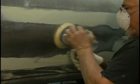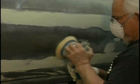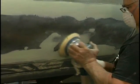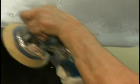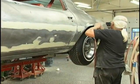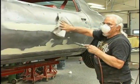This is critical. We're going to wind up DA-ing the entire car. In fact, many body men and painters begin with that 80 grit right from the beginning, before they even scratch other parts of the metal for excessive bodywork. It also shows up bodywork points, high and low spots, when you're using that DA tool. But nothing beats the hand. All right, remember to blow down between adds to get everything out of those grooves so that we've got a good scratch pattern for the succeeding coats of filler. Wipe it down real well before you mix the next batch.